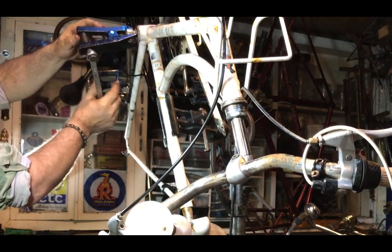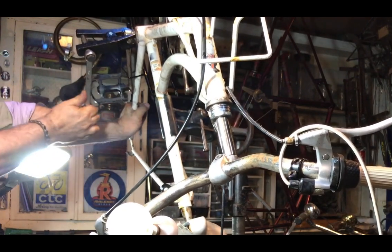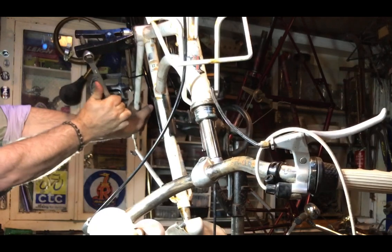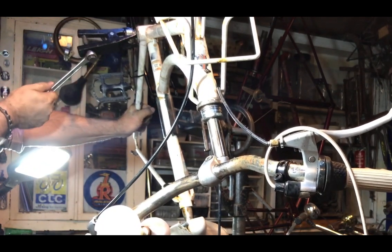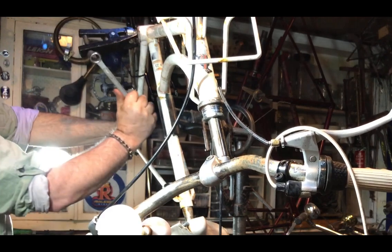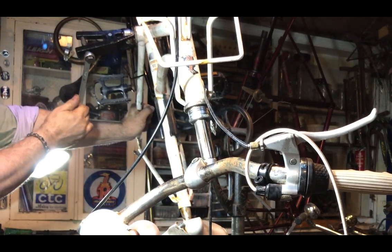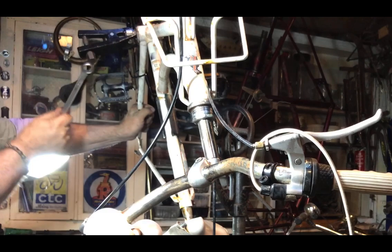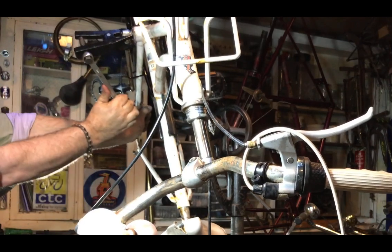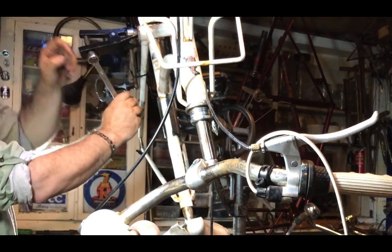I'm not sure, but I think the tool has got a bit of a bend on it. I'm thinking the tool might be about to break, which is incredible - so that pin is only held in on the taper. This tool is a serious piece of steel, but then that top part is a casting, so who knows. This part is milled, this is cast by the look of what I'm seeing here. Everything's going through this pin at the moment and through the threads here.